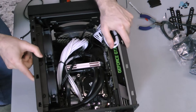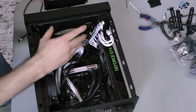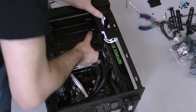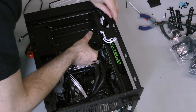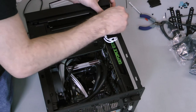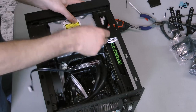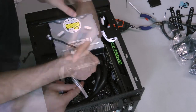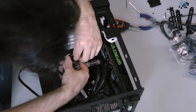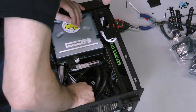Installing a drive peripheral in the five and a quarter inch drive bay is fairly simple. First, squeeze the two tabs on the inside of the case to remove the drive bay shield. Next, reinstall the five and a quarter inch drive tray by lining up the four notches — it will require a little bit of pressure to hold into place. There are six different places to secure the drive tray, but you really only need to screw in the two middle mounts. Insert the optical drive from the front and line it up with the front bezel of the case, then use the latch to lock it into place. Connect a SATA cable to the back of the optical drive and then to the motherboard, and tuck it down in the gap between the drive and the memory. Fish the remaining SATA power lead from the cable connected to the SSD and H100i, and connect it to the back of the optical drive.